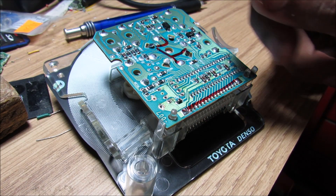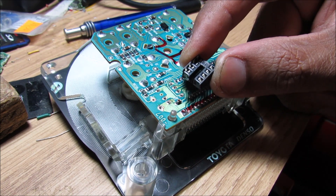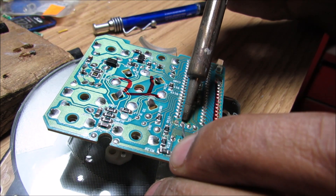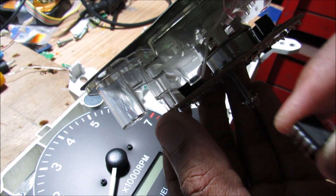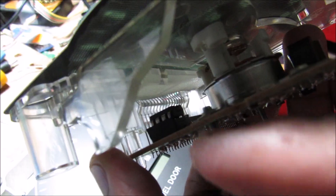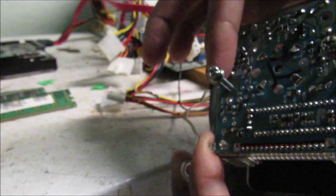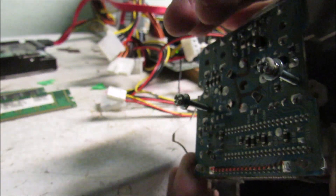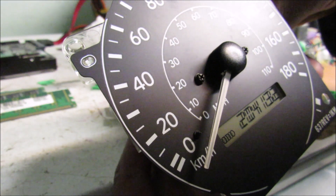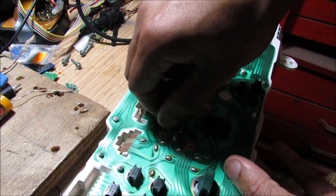I've got a little 8-pin DIP socket that I'm going to solder onto the odometer board so it's easier to do testing without re-soldering the chip each time. With the DIP socket soldered in, I can just plug the chip in directly. Before replacing the speedometer into the car, you can test it by applying 12 volts to the terminal and ground to the wire — and you'll see it reads 204,132 kilometers.